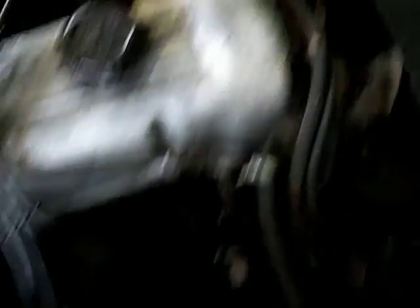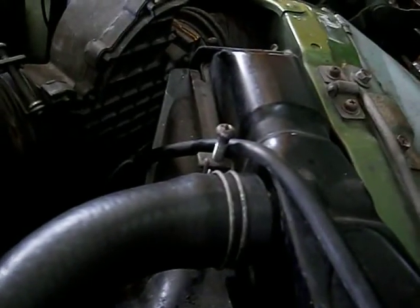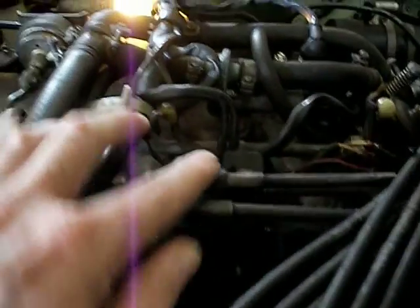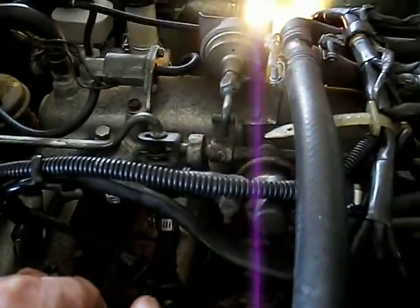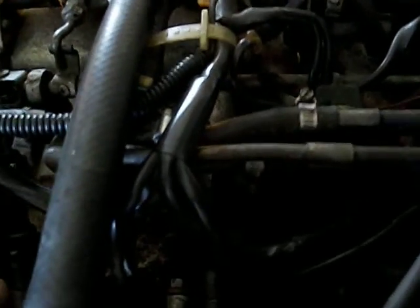The positive cable was okay. I also need to replace the radiator hoses, so I've got some new ones — top and bottom — and I used the correct hose clamps. What I need to do next is go through and replace all the worm gear style clamps that were used on the EFI. That wasn't me, so I have to go through and replace those. I'll probably go down to the junkyard and get some, because they're better than the cheap garbage you buy at the auto parts store.